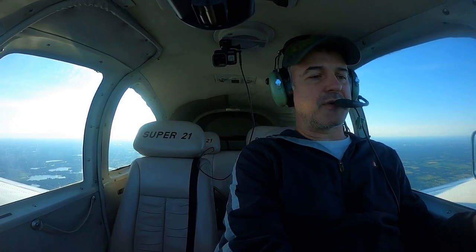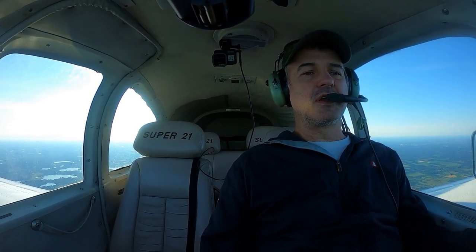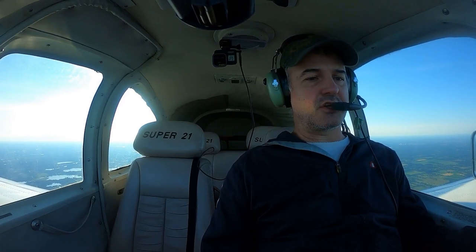All right, we're up at 4,500 feet. We'll do a data point here. We'd expect us to pick up some true airspeed if we're using the exact same power setting as the density altitude increases. So we'll give that a shot. I just need to trim it out here.